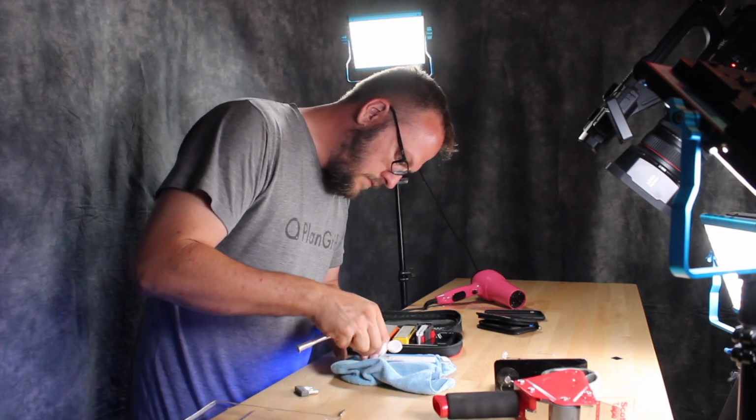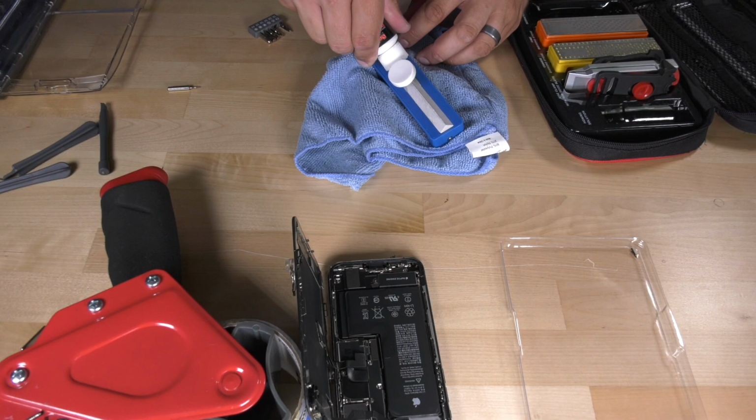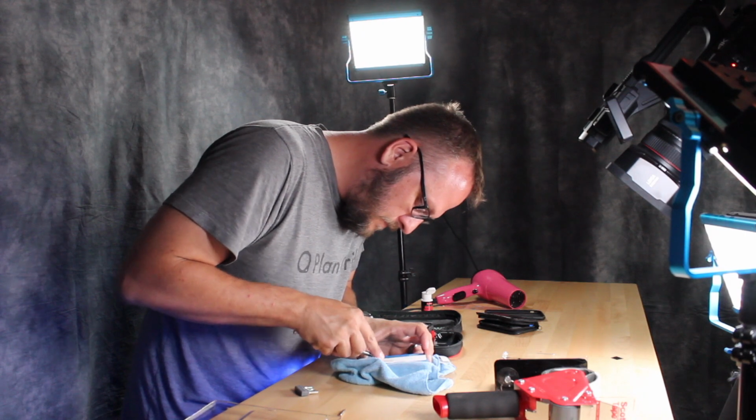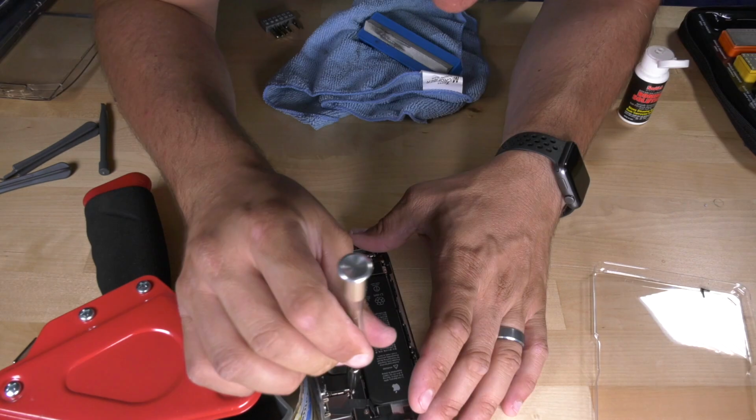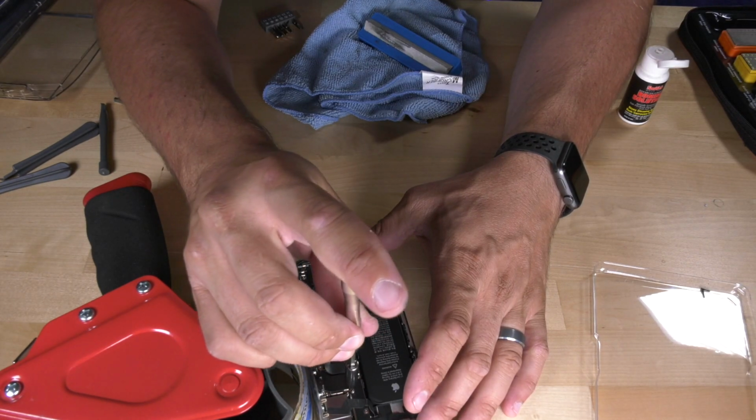Now, be careful. I've learned my lesson over the years. It's okay to give it a little shot and try to maybe hillbilly engineer something together to get it to work, but don't press your luck because you'll end up stripping heads out and it can be really ugly. But I tell you what, I went and found an old knife sharpening kit that I probably haven't pulled out in 5 years out of a closet, and decided to take one of my other tri-bits and just start to try to sharpen it so that I could get it into the tri-bit head. But it didn't work. It was like 20 minutes of my time just totally wasted.